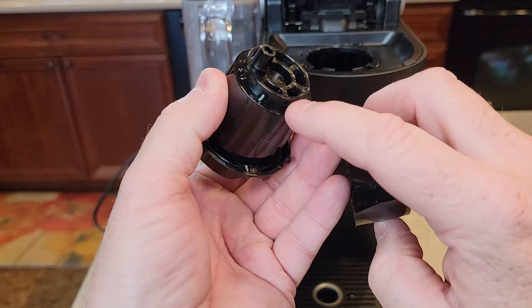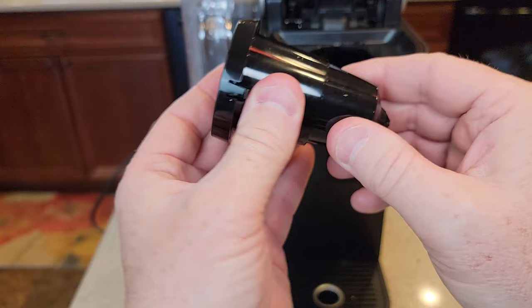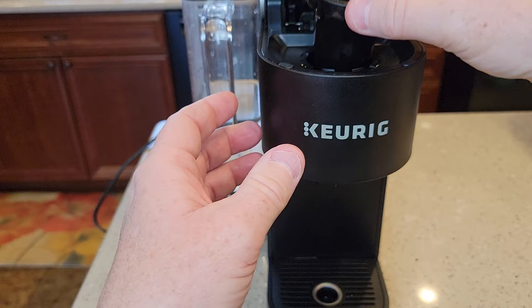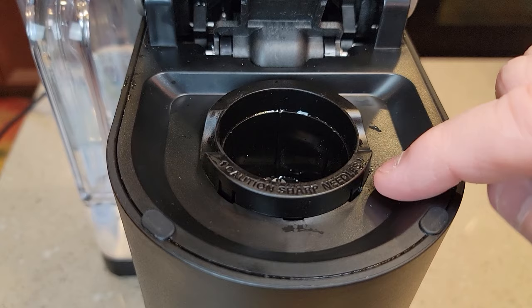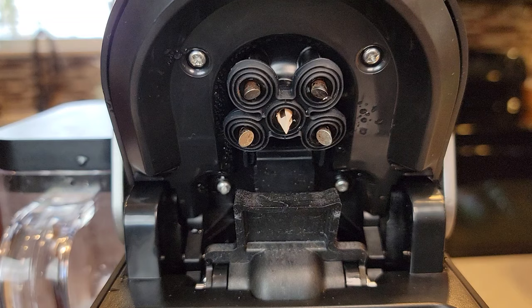To put this back together, there are two little ears on each side — actually four total. Line those up with the little holes and it'll snap on; it doesn't turn and it's on there pretty good. Now the way you install this: you're going to see the words 'Caution, Sharp Needles' — those face you. There are two ears here, so put it in and snap it in. Make sure it's nice and flush, the words are towards you and you can read them. There's the bottom needle all clean.